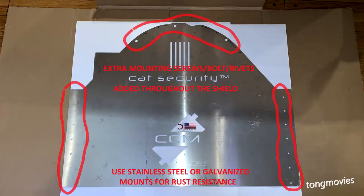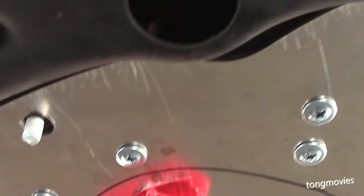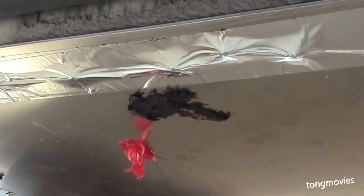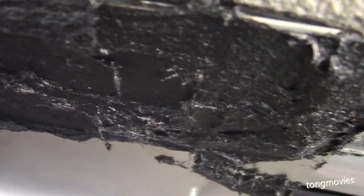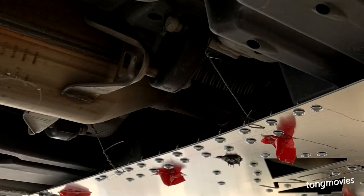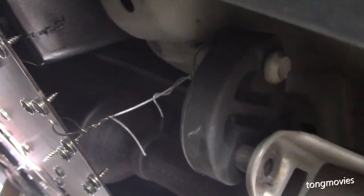Let's start with stronger. The easiest thing you could do is to add more screws, rivets, and bolts. The more you add, the stronger it is — they'll have a more difficult time prying it off. Second, mask the screws with something like high quality aluminum tape, which makes it harder for them to find the screws. Number three, cover the screws with tar, before or after the tape, so if they try to cut the screws off it will be messy and more difficult to find. Be careful where you put the tar because it may melt in hot spots and cause a smelly mess, so experiment first. And finally, I've tied two wires as extra support for the shield — it makes it stronger and adds another few seconds of work to remove, assuming they have a wire cutter.